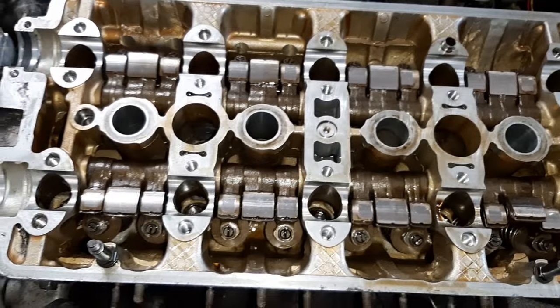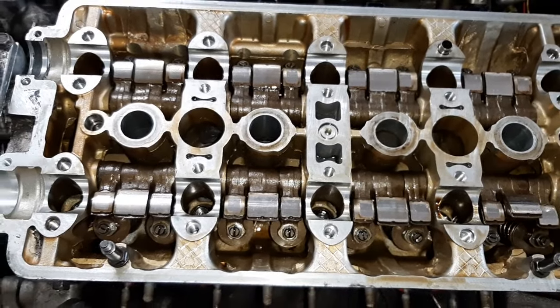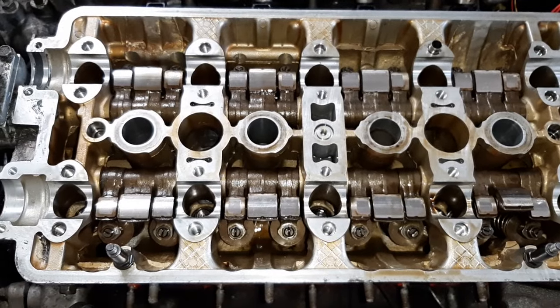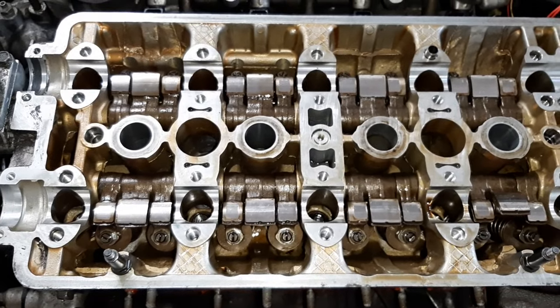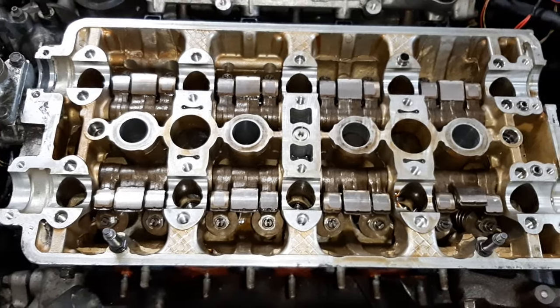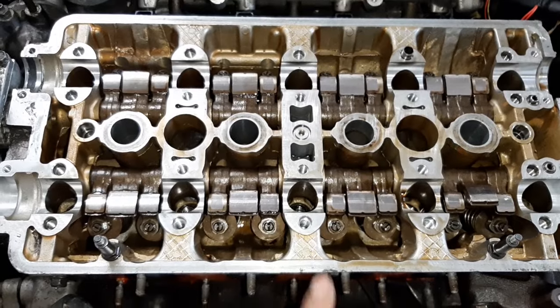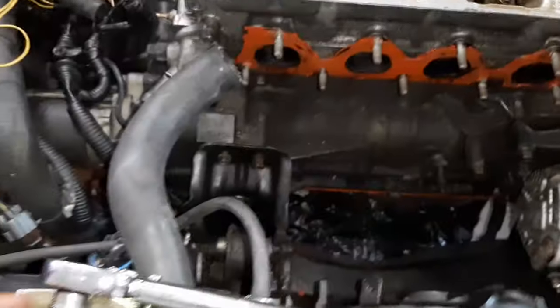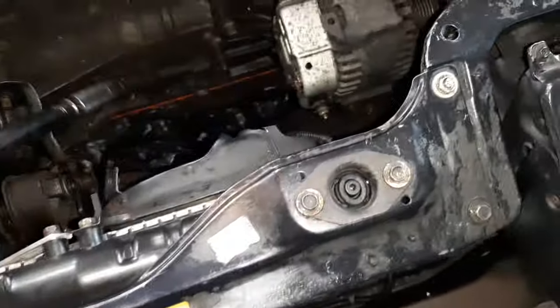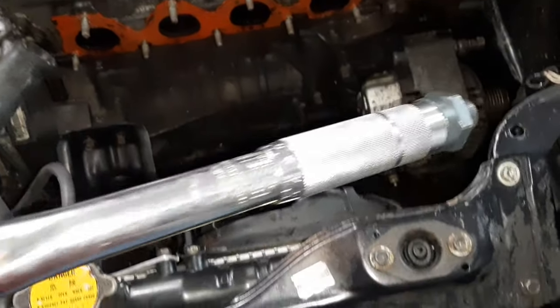And tightening, first I set the torque wrench to like 20 foot-pounds. Then I set to 35, then 50, then 65, then 72. For H22A, most of these Honda engines are 72 foot-pounds torque, right? So you need a torque wrench like this. Oops. And the setting is there.